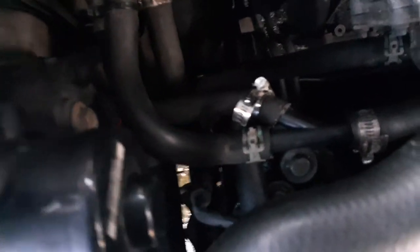Just one more complexity. What you do is take these two hoses — you don't want to cut them down too short. Here's the intake side, this is where the hot coolant flow comes in. This little guy right here, see below there, there's that next hose down. It starts bigger, you get smaller. You're going to cut that down, make room, put a Y fitting right in there.